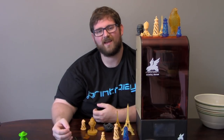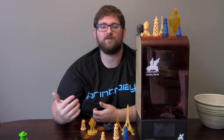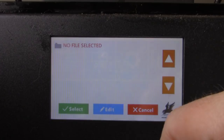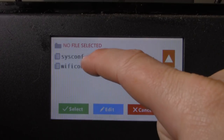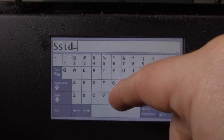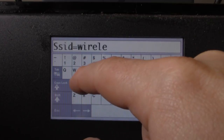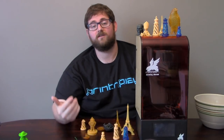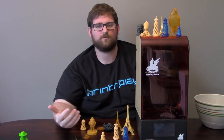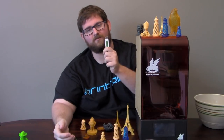Setting up Wi-Fi on this thing is a bare minimum affair. While some printers offer their own access point or give you a list of available networks, this one's Wi-Fi configuration is handled through an integrated text editor. You go into your Wi-Fi.txt, give it your SSID and password — which are stored in plain text. While I did confirm the functionality worked, I wasn't comfortable storing my Wi-Fi information in plain text on the printer, so I went with a USB-based solution instead.